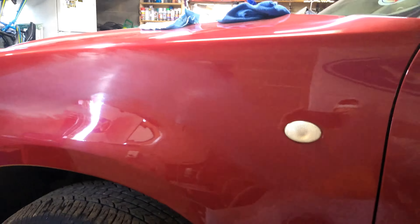So we're going to keep on working at it. We're going to pull out the polisher and polish this piece up, then move on to the next one. We might go to the back first and see from back to front if we're going to need to clear coat it or if polishing will be fine. I've got really close — you can see where the scratch was. I think I went through the clear coat right there, but we're going to try to polish it anyway. This isn't a fancy vehicle, just a cheaper vehicle we got, keyed all the way down the side. We're going to make it look a little better before we put it out on the lot.